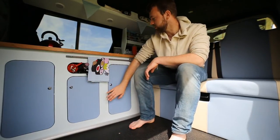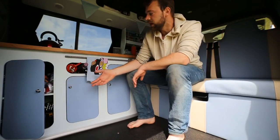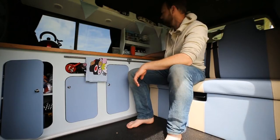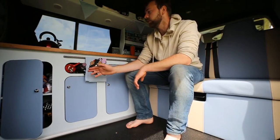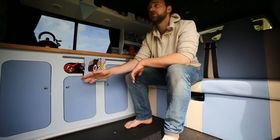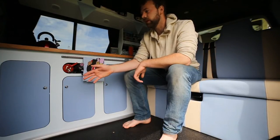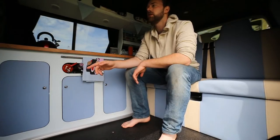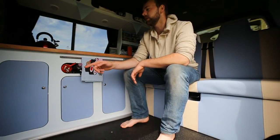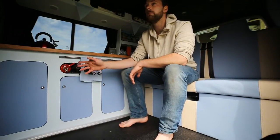I've got three cupboards down here. The one on the left is the inverter - you've also got all the 12-volt stuff in there including a fuse box and everything to do with the leisure battery. There's a shelf above it for food and cooking items. I have a 100 amp AGM leisure battery under the seat - you can generally take AGM batteries down to about 50% charge regularly without damaging them, so I get about 50 amps of usable power. It charges off a split charge relay - the van had a subwoofer previously so already had the power supply and a trigger circuit off the radio, so whenever you drive with the radio on it switches the split charge on and charges the battery.